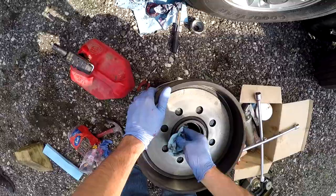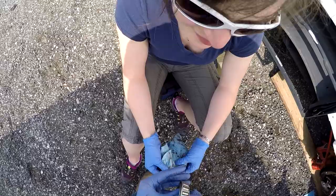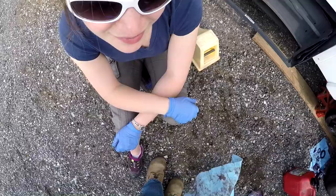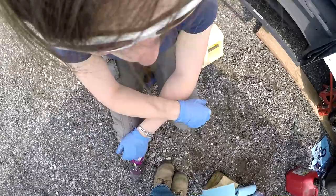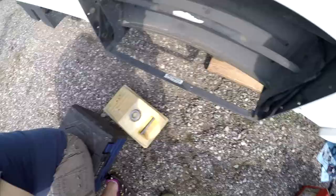How's the bearing coming? You can test it by locking it so it doesn't spin and spinning one part at a time on a clean sheet — if you get very little grease on the sheet you're pretty good to go. I like to use a completely clean sheet so you can really tell how you're doing. That's looking very good — pretty clean. Let's set this on a clean surface, not in the gravel.